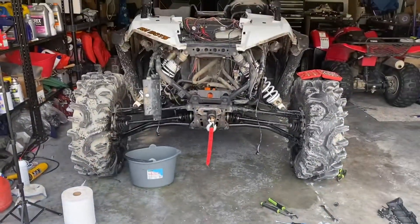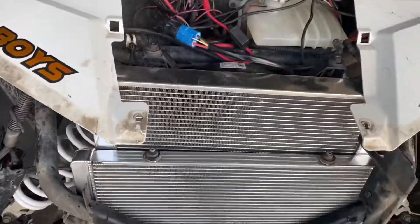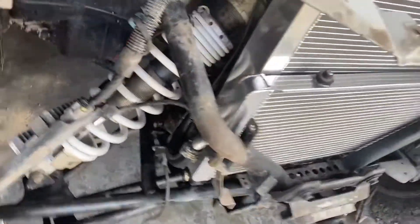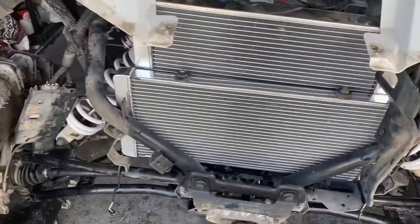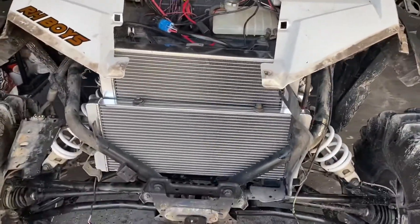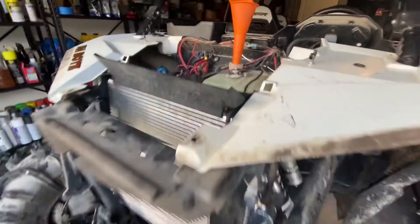We got the fan put on the new radiator. We've got the auxiliary radiator ready to go in and both old radiators are out. We can slide them back in and get everything buttoned back up. Both radiators are in — not quite level yet — but we've got all the hoses connected, all of them are back in. Now we can start putting the brackets and pieces back together and then start bleeding the system. The reservoir is as full as it'll go right now.